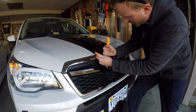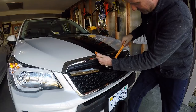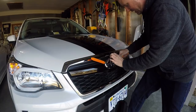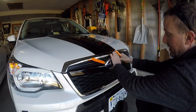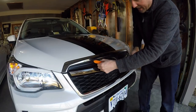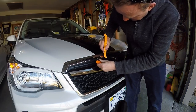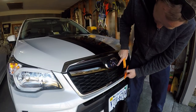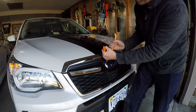Then it's really a matter of gentleness, carefulness, and being patient. Only use plastic tools, as the plastic is ripping before the chrome emblem gets a divot in it. I'm going to take my time and work it around as best I can, along with heat in the cracks once I open it.